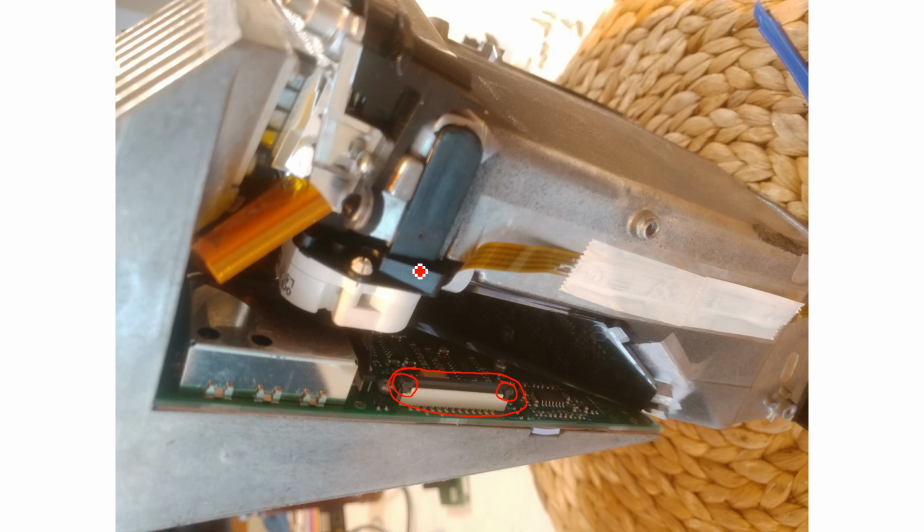So we've got a few things going on here now. We have this white thing. This is the servo for the shutter that we'll talk about later. This is what opens and closes that shutter. We've got this blurry boxy thing up here. This is actually the LED matrix. This is what provides the backlighting for the projection. So if you were really crafty and you wanted to change the color of your HUD, you might be able to change the LEDs in here. I think that's about it. This ribbon cable here goes to the servo that you'll see later.